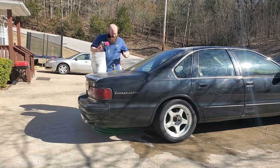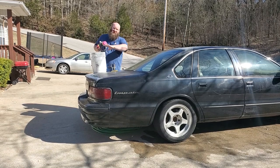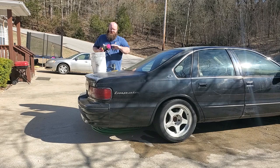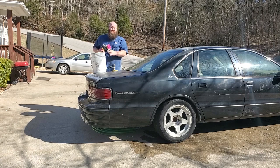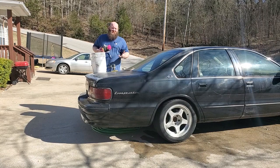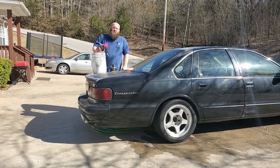So what I'm going to do now is I'm going to pop the trunk, pull the rear wing off. I'm not even going to concern myself with the rear wing at this moment. It's a polymer wing. As far as I know, it requires fiberglass work and Bondo work and sanding prep and paint and all that. And I think probably that will be pushed to when Jody and I actually paint the car, because I don't see any benefit in cleaning it up any further. Sun has already killed all the paint on it anyway. But anyway, yeah, so I'm going to tape, get that pulled off, and then I'm going to tape up this window and all this area here just to make sure I don't oversand.